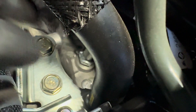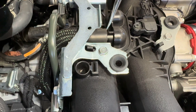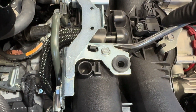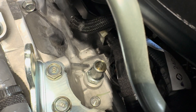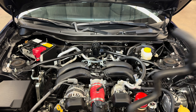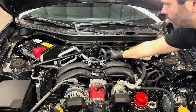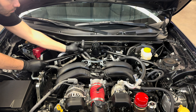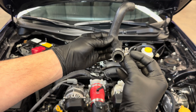Next thing, we're going to be removing the PCV hose on the bottom end where it connects to the PCV valve. You just pull on it. On the top end, you just use a pry tool and you should be able to get the hose off, just like this. Go ahead and wipe everything off — there will be a little bit of oil. For the feed side, where it's going into your catch can, that's the hose. That's the orientation for the outlet where it goes into your intake manifold — that's the side and that's how it's going to go.